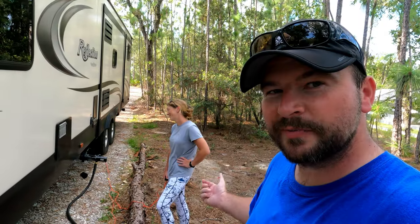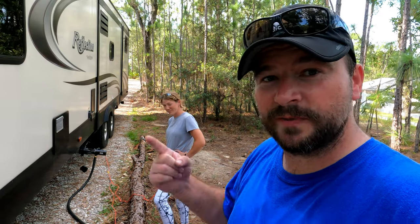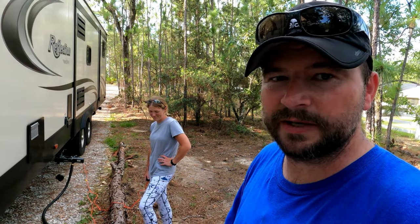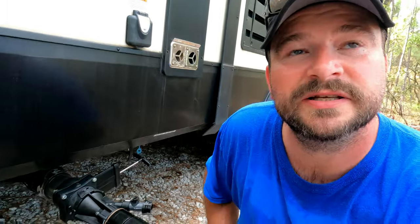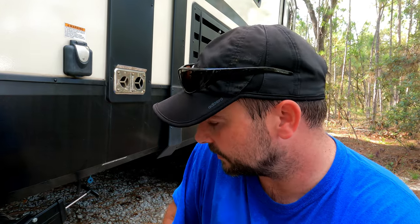With my assistant pressing the button, I checked the toilet — all very clear. This thing pumps so much quicker than I ever thought it would. We hooked up the black tank flush to make it quicker since standing on the toilet flush to fill it with water was a pain. We also have the Valterra valve because our original black tank valve actually leaks a bit — and the clear window on it is the best thing I've ever bought for our trailer. Very happy with the macerator overall; we recommend it and will put the link below.